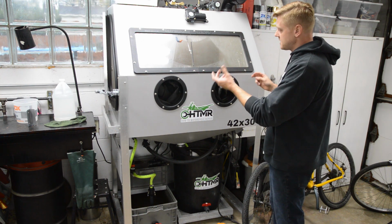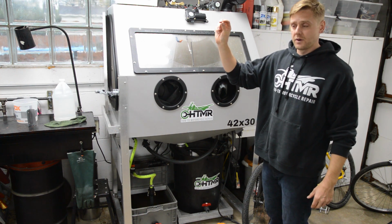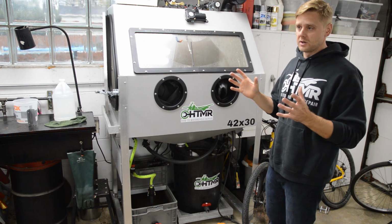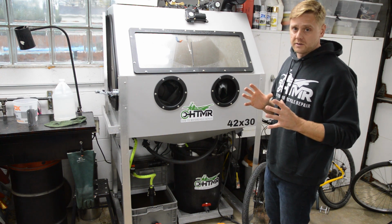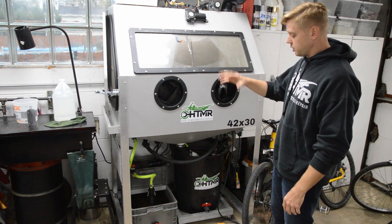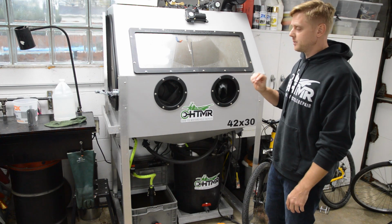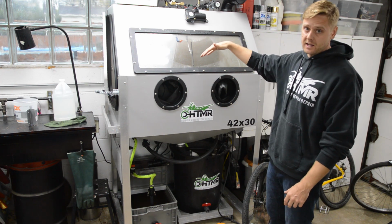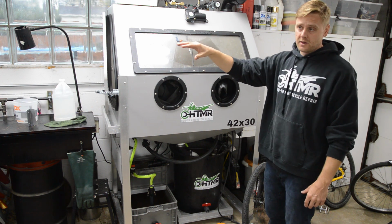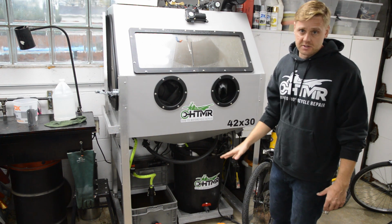So you can do your blasting, take it out, and you can have a clean treated dip tank for all your metal parts, and that way you can minimize the amount of product you use and therefore the expense. Okay, also this is a closed loop. If you had an open loop, it would be even worse because you would be adding tap water to the system, diluting the 102, so that's not a good situation anyway.